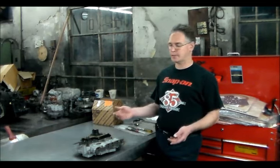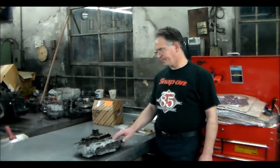This has a separate module. It's an early car, so it has a separate module, and the engine control module is a separate module. So the guy brings it in, we let it run, and we get it to happen. We get it not to start. And right away, notice that I have no communication.